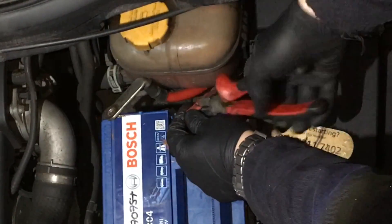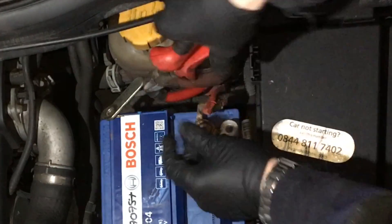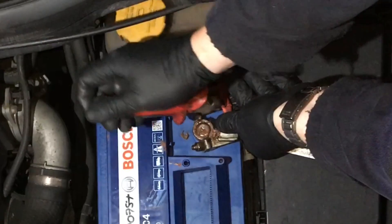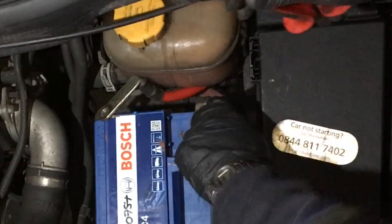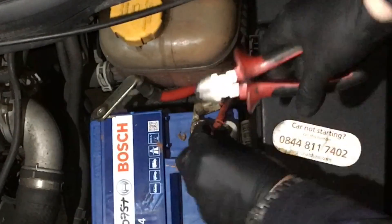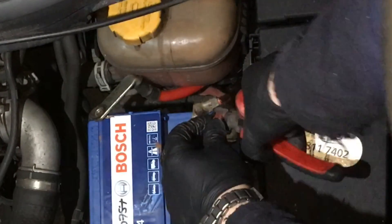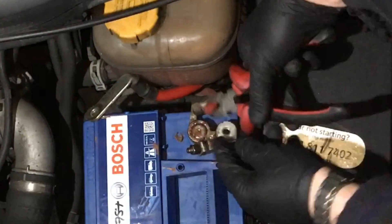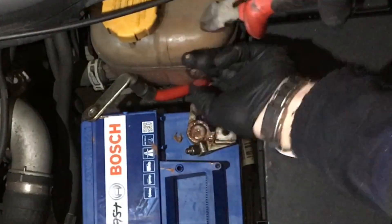What we've done is just chopped straight off through that big wire with the side cutters. Now we're just going to peel back the insulation by chopping around the outside of it, just to give ourselves a bit of a chance of pulling it off, because they are a bit tough — it's quite a thick insulation on that.